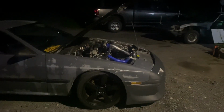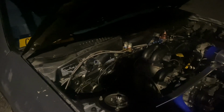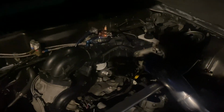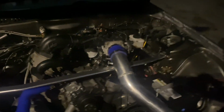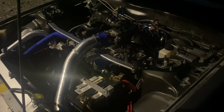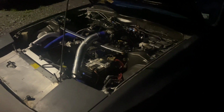The fuel pressure regulator crapped out. It's actually good that I wasn't using the nitrous or anything yet, because I am waiting on the throttle body spacer as well as my 4-inch piping kit so I can get this away from the hot air. I started adding a bunch of timing to it today because these RX8 motors like timing to keep the EGTs down. Fine line, for the most part.